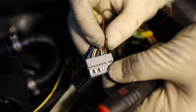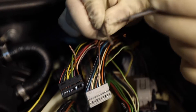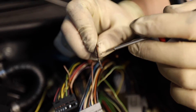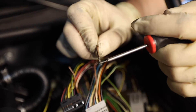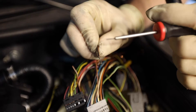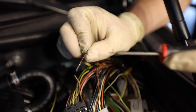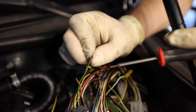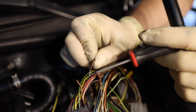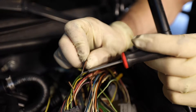To remove pin 13, you can use either a needle or a Snap-on pin remover tool. Push it down to unlock it and pull it out. This wire is going to go straight to the DME pin number 20, connector X60002. We'll use this particular wire because it already has a pin on it — it doesn't really matter which one you use, but we'll put this one on pin number 20.